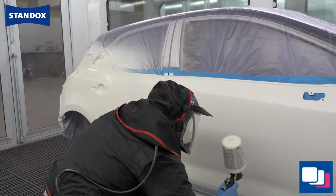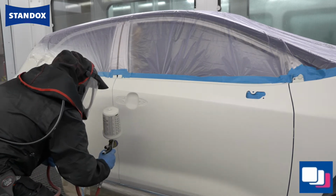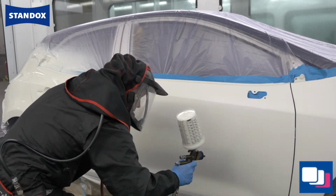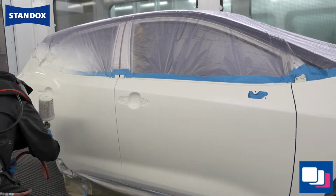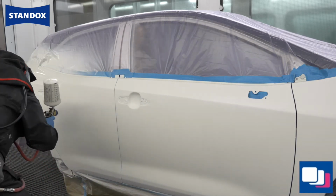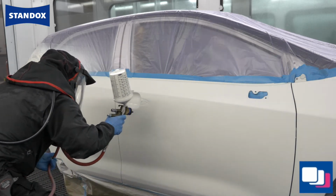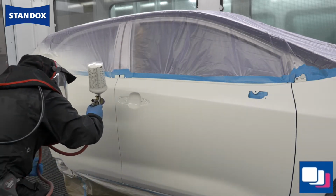Product adjustment is even more important when the job is as large as this, and basically I've got two overlap zones to consider, so using a slower adjustment is the sensible thing to do. When planning your job, try to do it in a way that minimises the amount of overlap zones so as to reduce the possibility of dry spray forming on the unpainted part of the job.